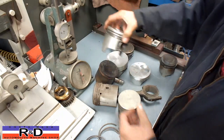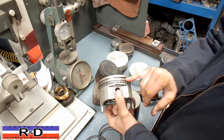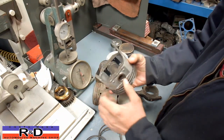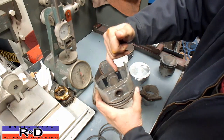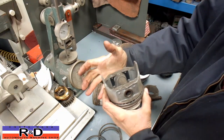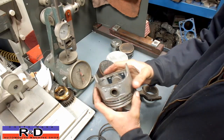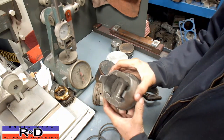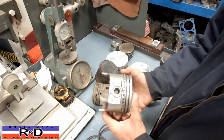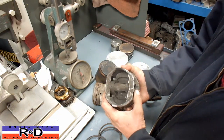Let's go on down the line here a little bit. This is kind of the next generation — thinner rings, again a three-piece oil ring which is nice. What we see in here is this little black portion — this is what we call a thermo elastic strut. What it does is it has fingers on this side and fingers on this side, and it actually holds the piston together as it heats up to stop — or let's say slow down — the expansion. And this one uses clips on the end to hold the piston pin in.